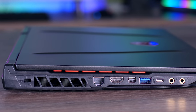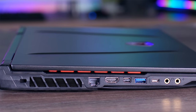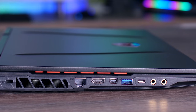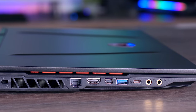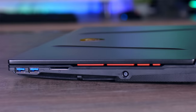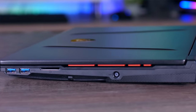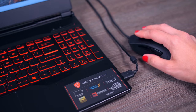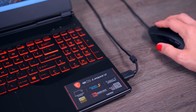There is one fast USB 3.2 Gen 2 Type-C port, three USB 3.2 Gen 1 Type-A ports, a gigabit LAN, an HDMI port, a mini DisplayPort, separate audio and microphone jacks, and a fast SD card reader. The only real thing missing is Thunderbolt support. The position of some USB connections is not ideal — plugging anything other than a small dongle into those front-right ports will just be in the way of your mouse and you'll constantly bump into it while gaming. Putting them a bit higher up or on the back of the laptop would have been much nicer.